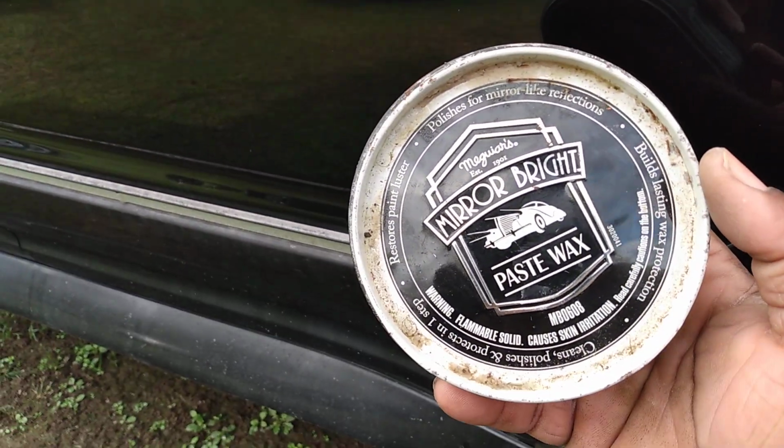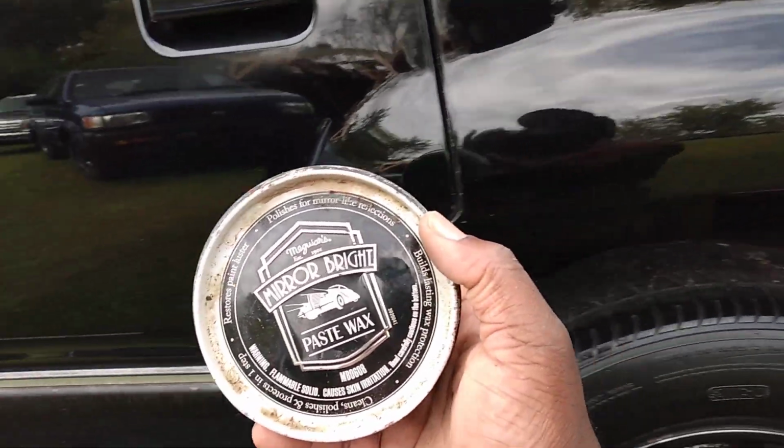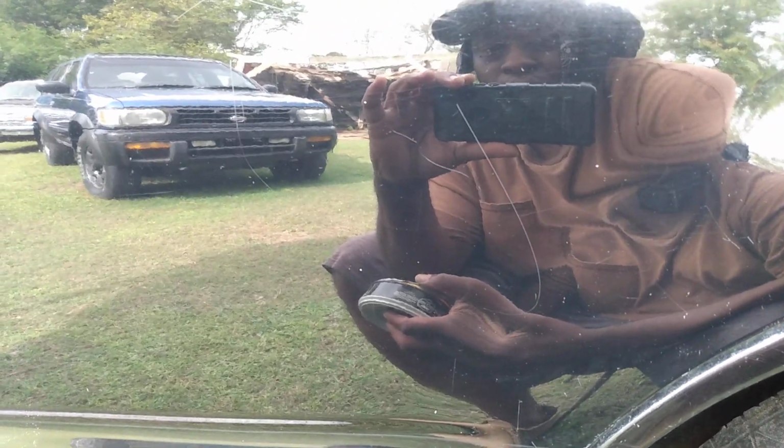It ain't coming out, but it did take down those water spots. Like I tell you guys, certain scratches like that are just too deep, and they ain't coming out. You can grind on it all night and all day, and it pretty much ain't coming out of there. It does look better, though. I would say it looks better. So this stuff is amazing, guys. It did a good job at adding gloss and protection as well, but it didn't remove that scratch as much because it's a thumbnail scratch. So pretty much nothing will work but something like some Turtle Wax pigment. We're gonna try that next.